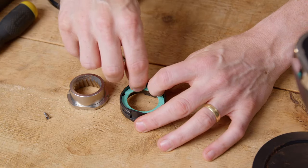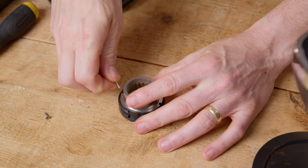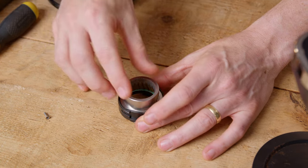In case you're not familiar with the concept, shimming burrs just means raising one of them slightly by putting something thin under it. It's something commonly done to align burrs, but what you can also do is put a shim under the entire burr to raise it up, decrease the gap between the burrs, and therefore shift the grinding range finer.